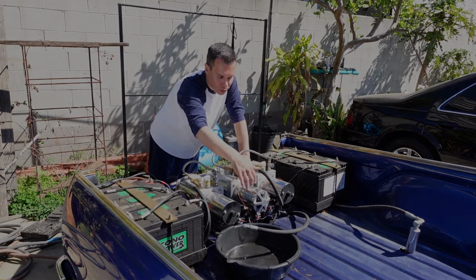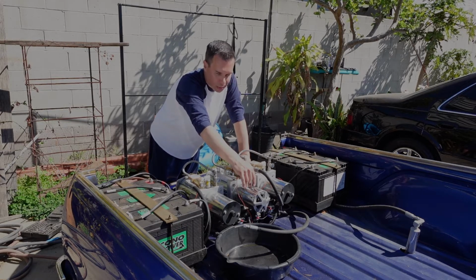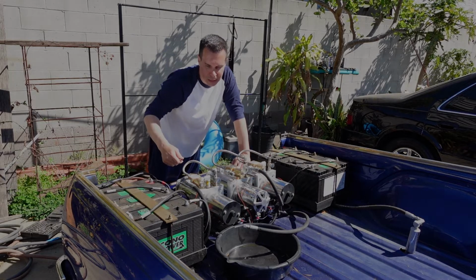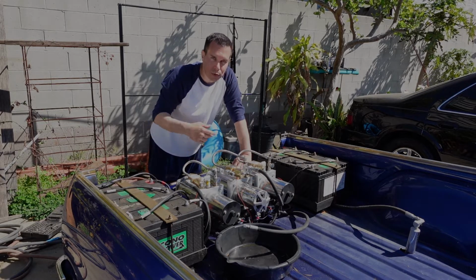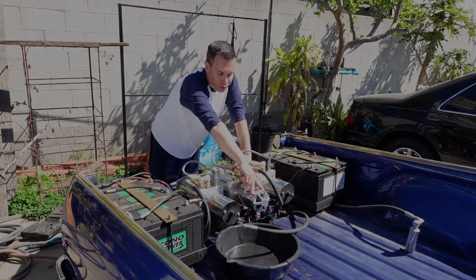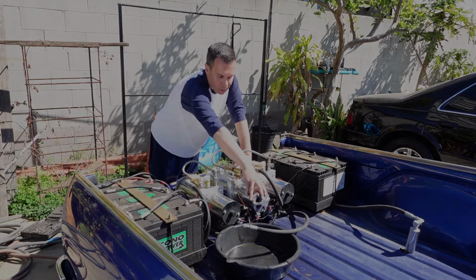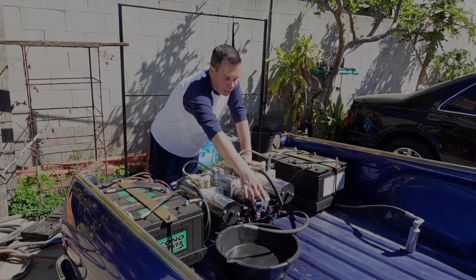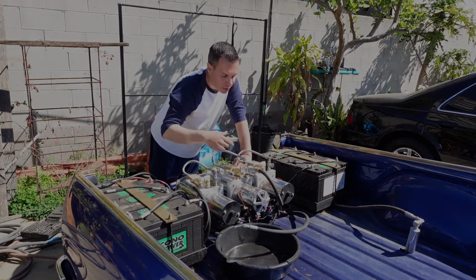Most of these are usually 12 or 24 volt, but in any hydraulic setup, of course, we're running basically 60 volts, 72 volts, or even higher than that. So of course you want to keep the motors as cool as possible. So that's why, especially on the front pump, you'll always see something with a ball bearing end cap and something that's vented to keep it as cool as possible.